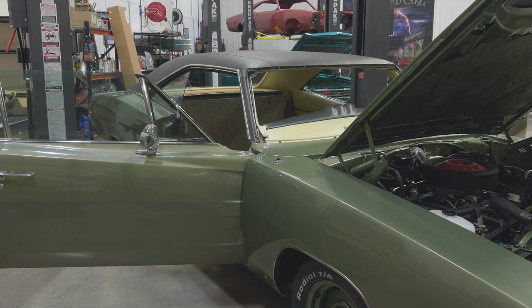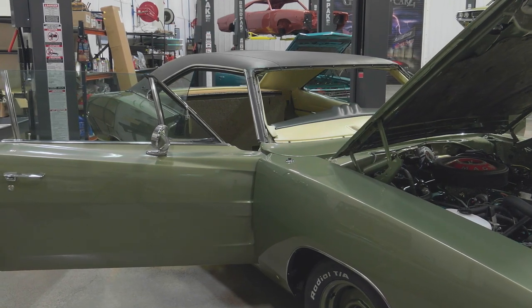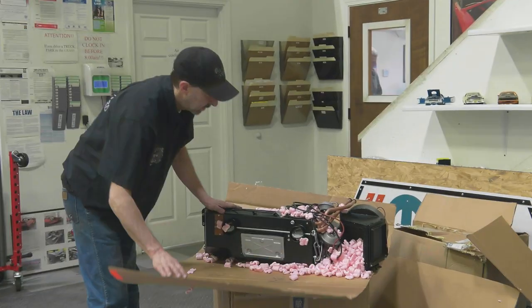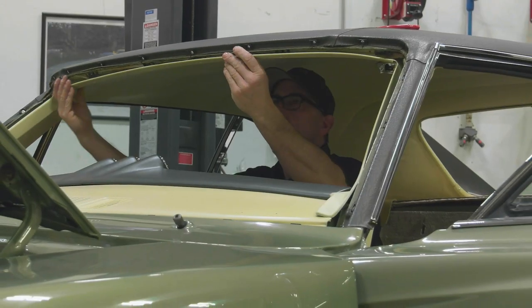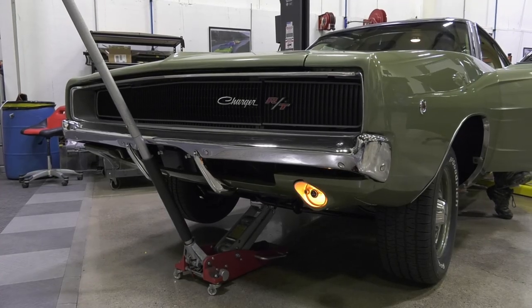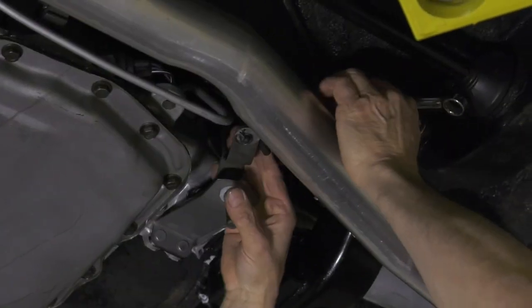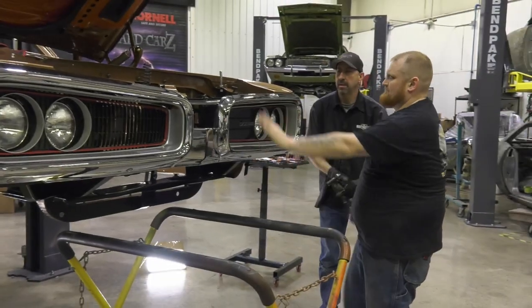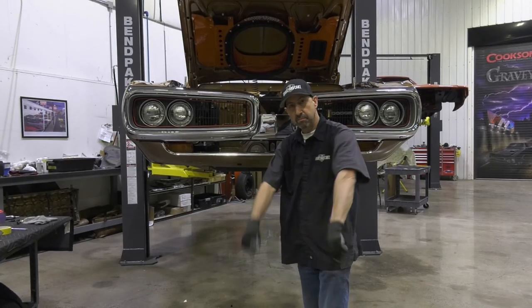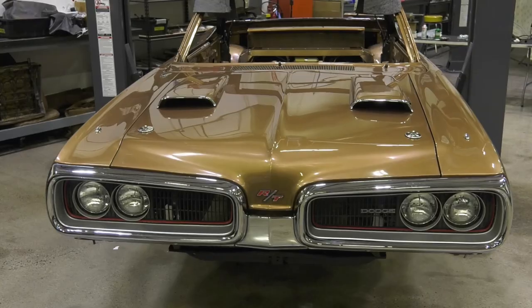It's been a really productive week here at Graveyard Cars. On the 1968 Dodge Charger RT, we got that unique heater box in, the dashboard in, A-pillar moldings, upper reveal moldings, and all the interior ironed out. The steering wheel turn signal issue: fixed. Shifter linkage not going completely into drive: fixed. That car's just about ready to go — all we have to do is get the AC charged on it and it's down the road. The '70 Coronet RT — got a lot accomplished this week, including this unique front end. Just an amazing, amazing week here at Graveyard Cars.